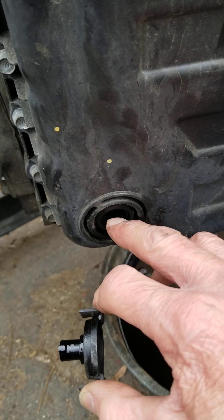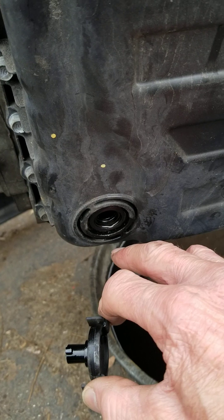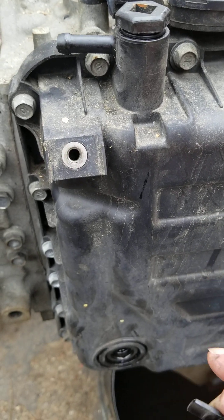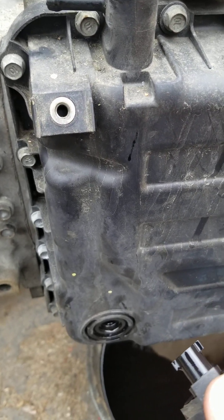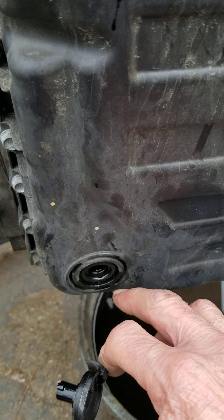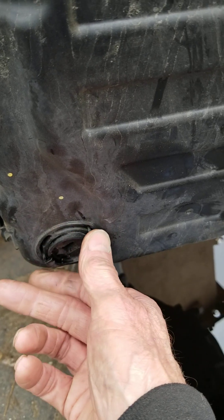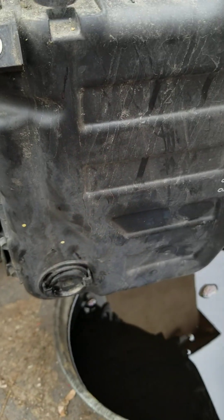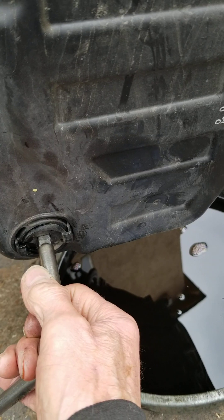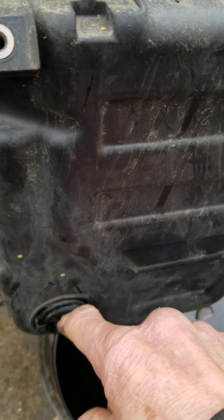When you pull this plug out, there will be just a little bit of drainage of transmission fluid if you have it at the right level. If not, go ahead and open this up, put a little bit more in there, and run it through the gears. What you're doing is getting the air out of all the clutches and getting the pump primed up. When there's a little bit of drainage out of here, go ahead and put that back in. Make sure you use a 3/8 extension to go in there and make sure it's tight — don't over-torque it. This cover is plastic.